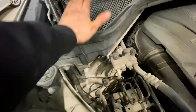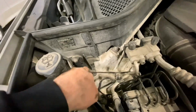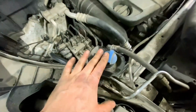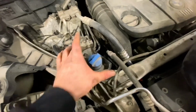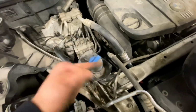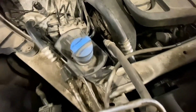So we went to the E-box, which was under there. There's a nice little conduit already open there for the wiring harness, and we're just running it down here. Very, very disgusting design. It shouldn't be on a car, I hate that. It should be way bigger, in my opinion, with a drain going down and out onto the floor, because this is very corrosive. Now, they're not bad. I've seen these plastered, but I've never seen one with a knackered fan LIN bus.